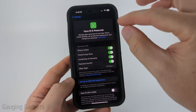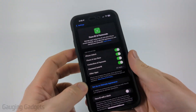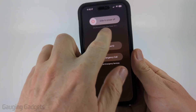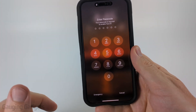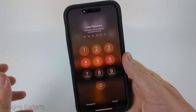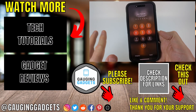Additionally, if you want to use Face ID for unlocking your iPhone but want to temporarily disable it, you can do that by simply holding the volume up and the power button on your iPhone until you see the slide for power, then select Cancel. The only way to unlock after that is with your passcode. As you can see, your passcode is required to enable Face ID, so Face ID will be turned off or disabled until you enter your passcode.